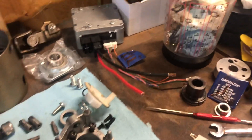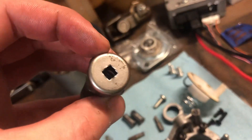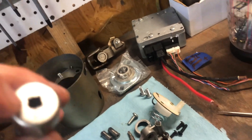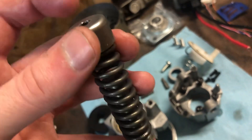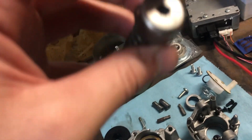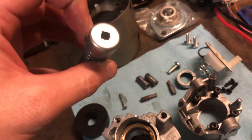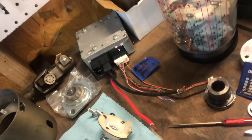Leave that piece in if possible — you don't need to pull it to mount the e-pass motor. When you go to pull the tilt spring mechanism, you'll see a cap on the end with little tabs. You need a square-tip screwdriver for this. The correct technique is to push this cap in, compress the spring, and twist it — you'll see the notches where it slides out. That releases the guide rod and spring out the front.